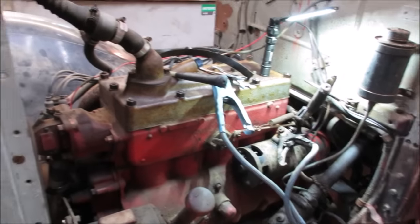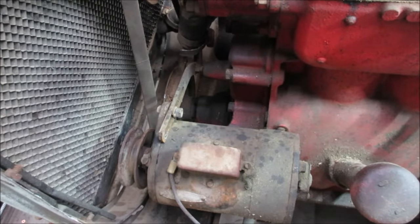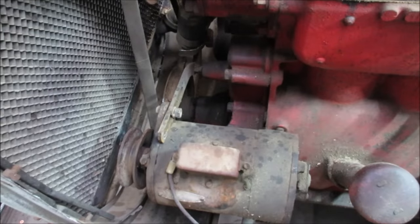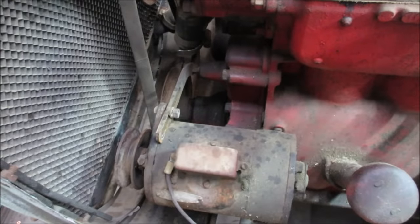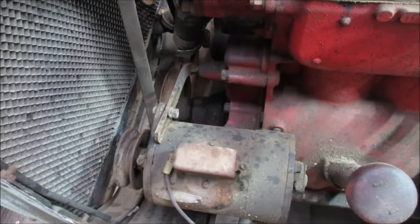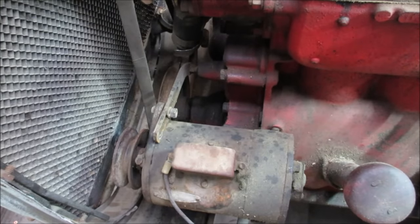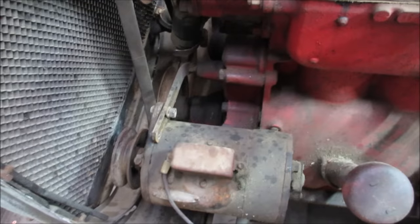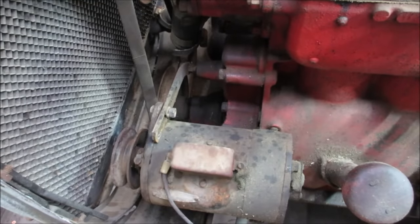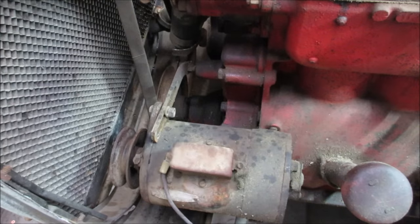Let me switch you up over at the pulley. Got a marks right there if you can see them. And it gets like an eighth of an inch at a time. Once we get it to spin, I think it'll be okay. I spun it by hand, it wasn't all that terrible. You figure the starter is supposed to be able to spin that with spark plugs in it. We don't even have plugs in it, so there's no resistance for compression.